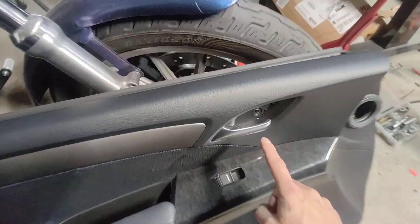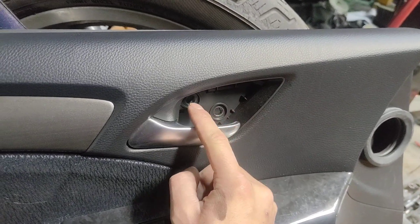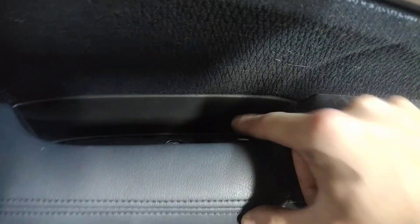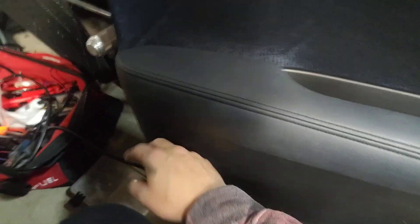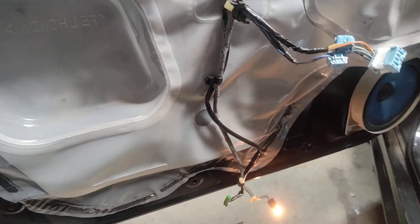To take it off you do have to take the door panel off. To take the door panel off, you've got to pry out the plastic piece behind here, take out two Phillips screws, remove the rubber liner in here, and take out that one Phillips screw there. Once you have that off, all you've got to do is pry out along the bottom of the door panel and along the sides, and you'll pop out these little clips that hold it in the door.